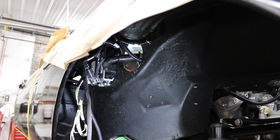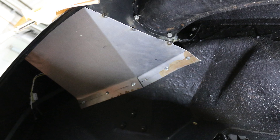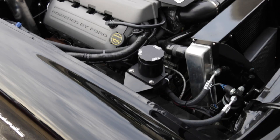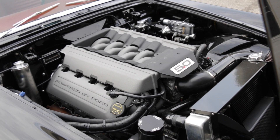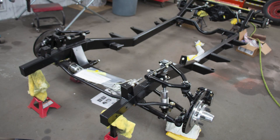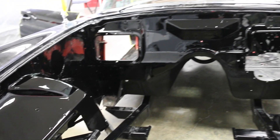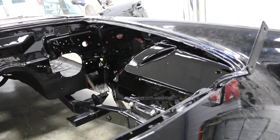We didn't cut the Ford harness — it laid in a certain place and conveniently the original blower motor hole in the passenger fender was right there, so we mounted the ECM inside the fender well and made a nice cover over that hole. All the other wiring and plumbing we run low, neatly tied up and clamped down so you're not seeing hoses and wires everywhere, and all the parts we make we paint to match — so everything looks like it was meant to be there from the start. We always consider aesthetics along with engineering: custom finish on the engine, painting the engine bay, hiding wires and hoses, routing A/C lines and heater hoses cleanly.